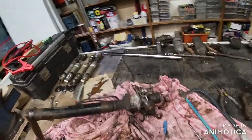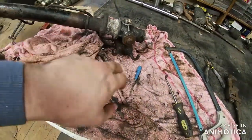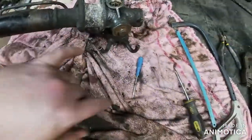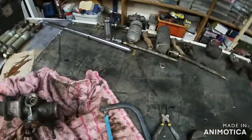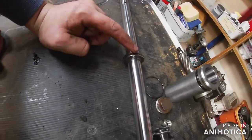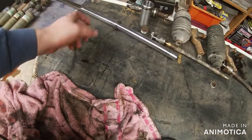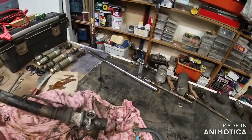Right, that's the rack in pieces. This is the pinion area - it's draining at the moment because it needs the last fluid out. I still need to take these two little pipes off - I've cut them two off. That'll blank the two holes after. Here are all the parts - you've got your main shaft, and then that there is the bit I need to cut off, because basically you've got fluid this side, fluid that side, so whenever you turn left or right that's where it gets pushed against. I need to get rid of that because it's just going to cause some drag.